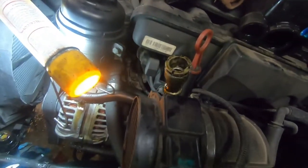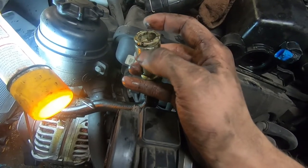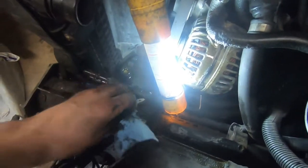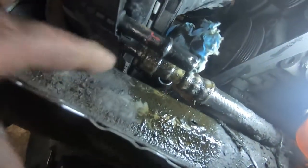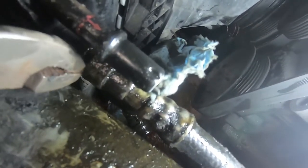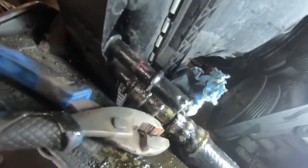The way this works: if you look at this line, it's got this little plastic piece. Sometimes apparently these do break off — if yours isn't there, you've got to use a slot screwdriver. You push this in on the line and then pull this towards the line, then pull the whole thing off. I sprayed a whole bunch of silicone lubricant in. You see the little plastic piece here — I took a pair of pliers, fit them around it, pushed this line in as I pushed that, and then just pulled it off. Basically, what this plastic piece does is it releases some little metal tabs that clip around the little rib here. You've got to do that if you're removing the whole front end.